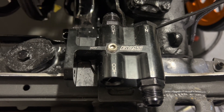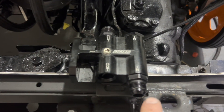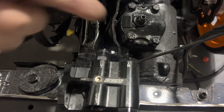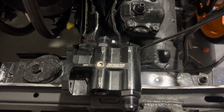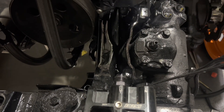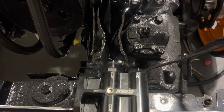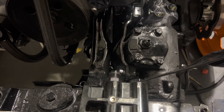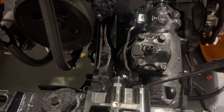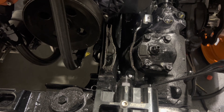The high pressure side is going to go down to that filter block there — that filter block is this right here, it's an Earl's 2077. This high pressure line is going to go to the inside of the filter block, and you can plumb this either way, which is why they're labeled in and out. The fuel coming from the Waterman to the filter head then heads towards the CP3s. Now it needs to go to a pressure regulator to regulate that pressure down to about 30 to 35 PSI, because if you have any more than that you could hurt your CP3 pumps.